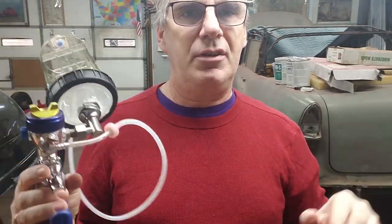This really cuts down on cleanup time. Instead of disassembling and cleaning the whole cup, you just pull your liner out and throw it away — your cup is clean and ready for next time. All you have to do is clean the needle and the gun internals. A lot less waste, no need to buy separate strainers — very good system, I recommend it.